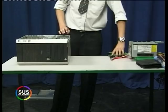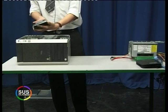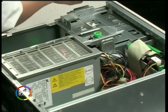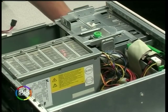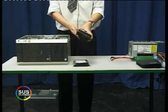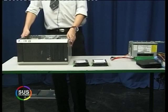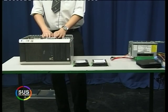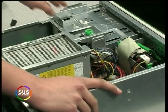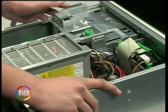We're going to be installing two SATA hard drives. As you can see here, one Samsung — you can see the ports here — and our second drive, which is a Barracuda one. First of all, what we're going to do is take out our IDE hard drive and put in our new SATA one.